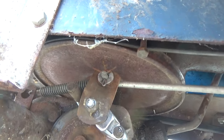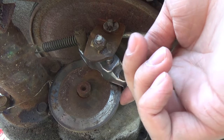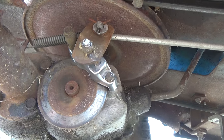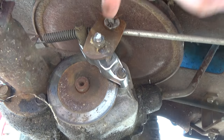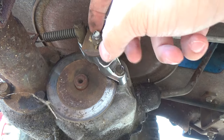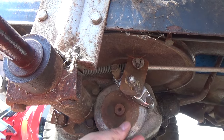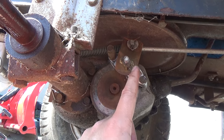With the brake pedal now engaged all the way forward, you can see the spring at the back is now extended. Now try to rotate the rotor — with the brake engaged, this rotor still rotates, which means we have to tighten this nut up even more. What you're going to want to do is tighten this nut up to the point where your rotor does not move with the brake pedal fully engaged. Then once the rotor stops spinning, release your brake just to make sure it does spin. If it doesn't spin, that means you have the first nut too tight, so back it off a little. It's just trial and error — you should be able to feel this thing starting to tighten up. I'm now at the point where this rotor is starting to grab on that brake pad, and you can physically feel it getting harder and harder to spin the rotor.